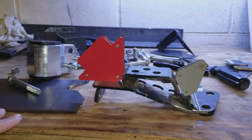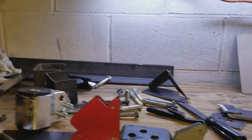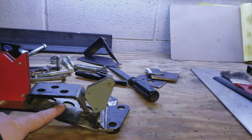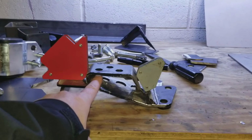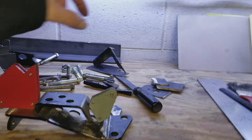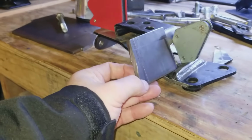But of course, I went to the hardware store, which, oh my God, hardware is so expensive. It's unbelievable. So yeah, I got all the bolts and things that I need, but I didn't get any M12 by 1.25 nuts, so I can't have Kenny weld nuts on the back of there until I do. But once I get these nuts welded on, then I could go ahead and weld this into position, and I've got another plate I'm making. This 1/4-inch plate will go on this side, as you can see how that's going to shape up.